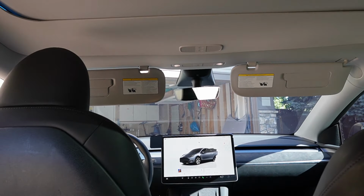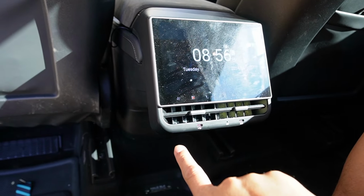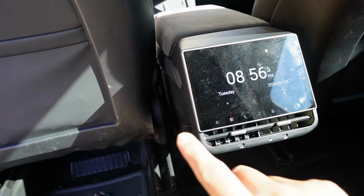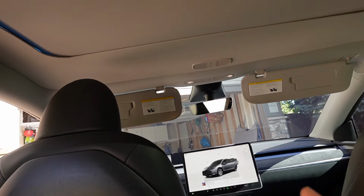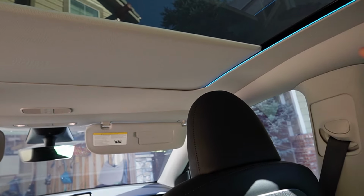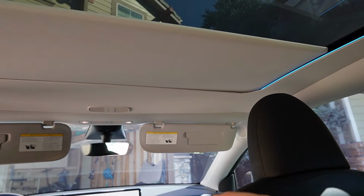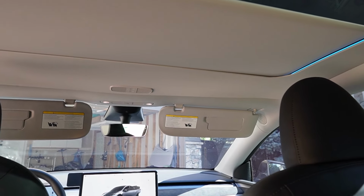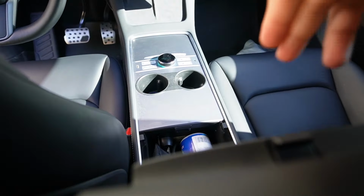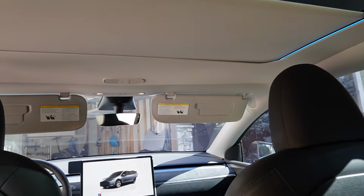The only thing that I mentioned before is that it has to connect to that center console for the power. But the benefit of that is that because it's connected directly to the car power, anytime you close the door and lock, the power will be off right away. So the lighting and the power to the power sunshade will be off right away, so it doesn't use the power right after that. Because if you get the power from the socket in here, it will stay on for a little while until it's actually turned off.